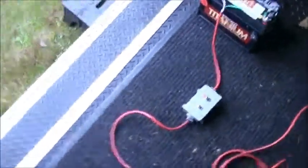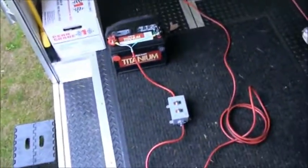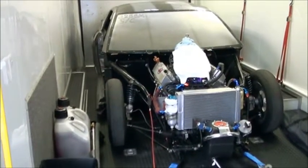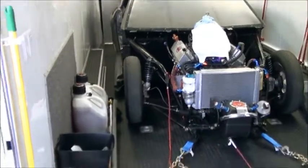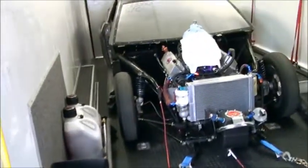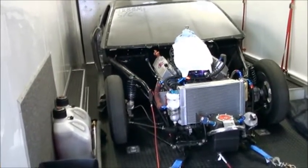Now we're going to come back to the junction box and all we do is turn on both switches. Now we can go back to the main switches in the car and turn on any device that we need. What you should see is the delay box is hot and the dash is hot — those stay hot all the time. So if we were actually making a run, we would turn the water pump and the fan back on and cool the car down. This also allows us, if we want to make any changes to the delay box, the ignition program, or the race pack, we have power and we don't have to use the 16-volt battery. This really allows you the maximum amount of charging time on the battery. When we're done and ready to go back, just turn it off, disconnect it, and then we'll be able to turn the power switch of the car back on and have our 16 volts for starting and running the next round.